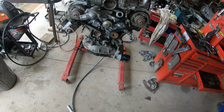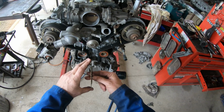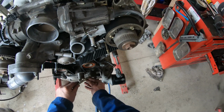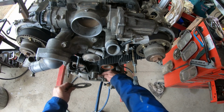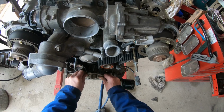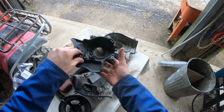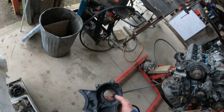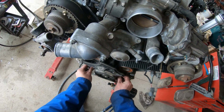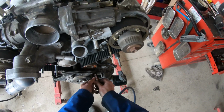So trigger wheel, make sure you put that in. And actually make sure it's straight. I had one of these years ago, non-VVTi, and when they'd pulled it apart, they'd bent the trigger wheel. So when it was running, it was actually moving across the sensor. It blew igniters up really fast. It was fantastic. And it took me quite a while to find it. So we'll put this cover on. We're not going to start it with the rattle gun.